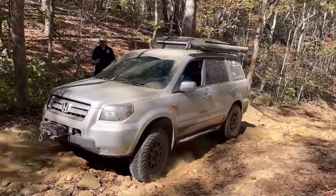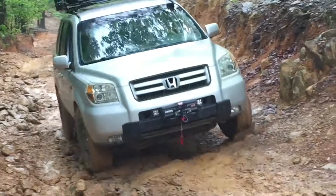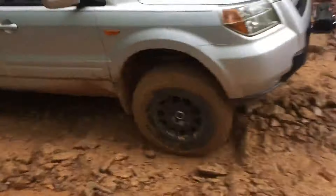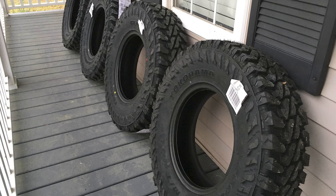There are advantages such as armoring against nicking your wheel. Also, when you air down with a larger rubber profile, it creates a cushion effect that helps protect the tire from popping and helps morph it to the terrain around it, giving you better traction. This epic hill climb right here really showed off how much shock absorption was built into our aired-down 31-inch tires. If it wasn't for our tires, our suspension and wheels would have lifted way more often. At the end of this run, we actually hit a stump and our tire takes the brunt of the hit, just absorbing it and actually climbing over the stump. Truly impressive.